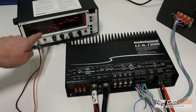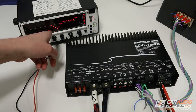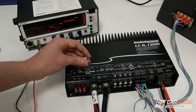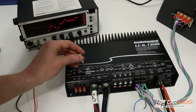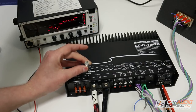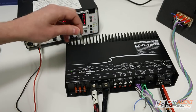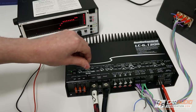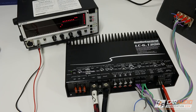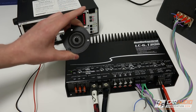With our crossover setting, right now it's set at 500 hertz, letting everything above 500 hertz pass through. For this tweeter, let's say I want to set it to about 1.7 kHz. What's nice is this has a tactile feel with little click indications rather than a dial that moves evenly. There we go — that's perfect and should work really nicely for our component tweeter.